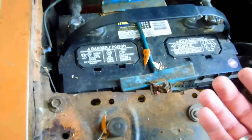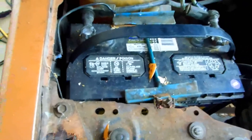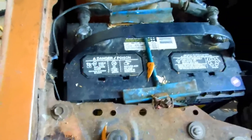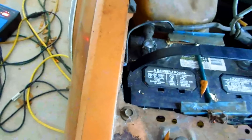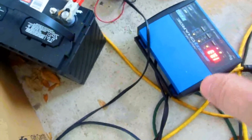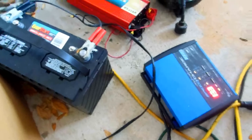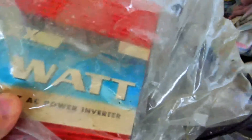If something physically breaks inside the battery, all these battery restoration procedures don't work. I was working on one battery I exchanged at Walmart for two weeks — I dumped it out probably 20 times out of sheer determination and just could not get it to work. Something inside the plates was shorted. Otherwise, if you keep them on a charger like this or a battery tender, they will last 20 years.